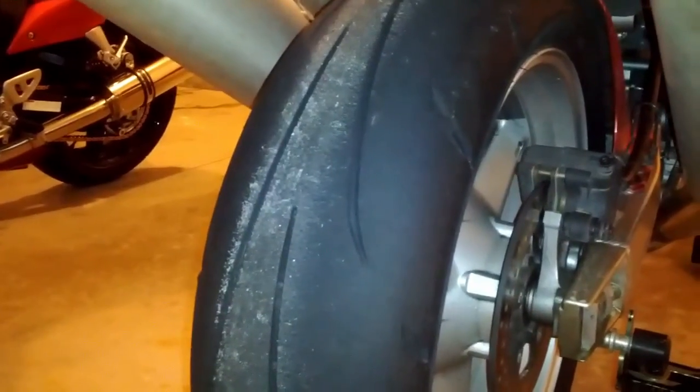After seeing the tire developed, it's small, you might not be able to see it, but there's a small hot tear that developed on the left side of the carcass here, which tends to indicate a slight overinflation. So when I checked the pressure after a particularly fast session, the tire actually heated up about 6 to 7 psi, which put it about 38 psi after the session was over. The 2CT on the front, though, only gained about 4 to 5 psi.